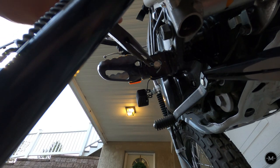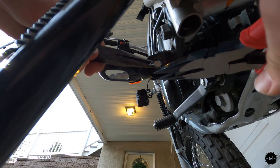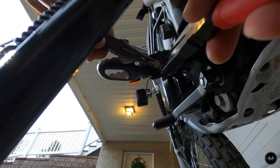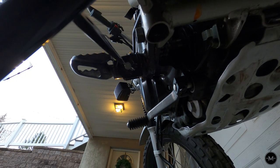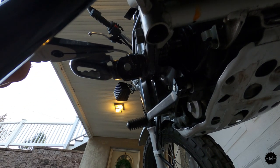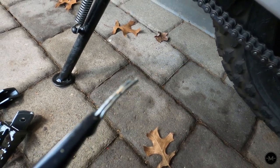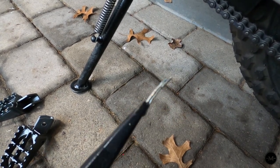I'm just going to turn the cotter pin a little bit so I can grab it with the needle nose pliers, and just slowly bend it out. It might actually be easier to hold one end and then take your other needle nose pliers and pull the cotter pin out. So finally got it — the cotter pin did slide out. When taking the cotter pin out, try your best to flatten it so it can slide out of the hole. It's definitely easier to talk about than it is to do, but you can usually get them out without breaking them.